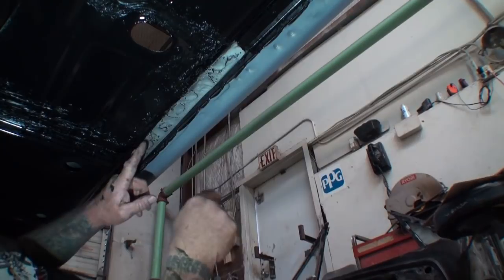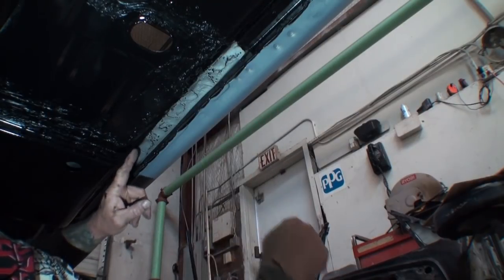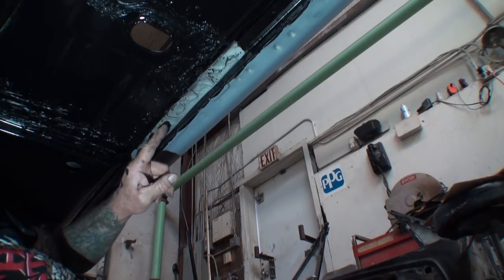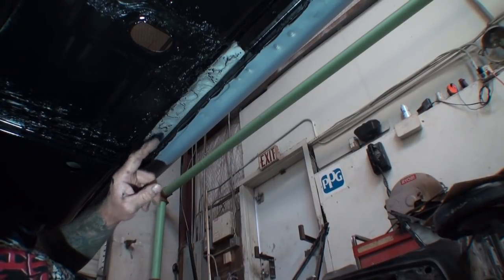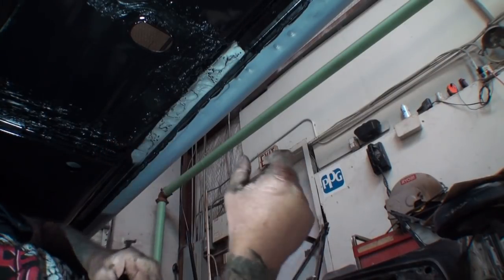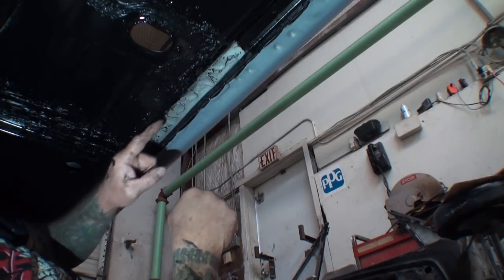All right, now that we have everything we need down here, before we do anything, we're going to have to get my air hose over here. There it is. Let's go ahead and prep our area up and get it ready to use our PC7 epoxy paste. So once again, before we go any further, this was sandblasted. If you have minor rust like you're looking at right here, you want to have that area abrasive blasted. You'll have to go buy one of those small Harbor Freight blasters, for instance, and you'll have to clean that out. You got to kill this rust, okay?